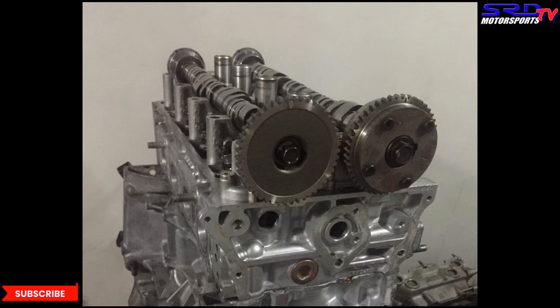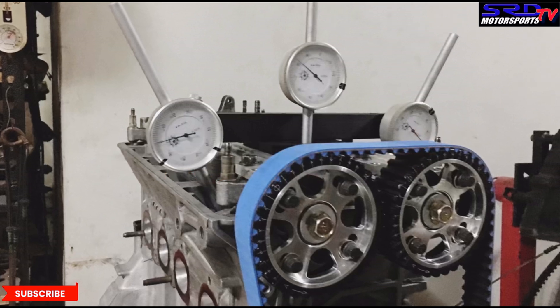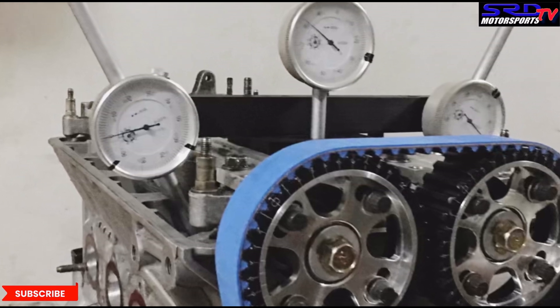Degreeing it gets the most out of the engine. A little trivia: Skunk2 Pro 2, Tuner 2, and even Pro 3 cams like 31 to 32 degrees of overlap — so that's effectively 31 to 32 VTC. They make the most power that way. Note it's overlap, not intake or exhaust individually. I started applying this to the B-series when I discovered the K-series VTC concept. That's why when you see me build engines I have four, five, or six scrap papers with notes — I rewrite them into a notebook or folder so I can always refer back.